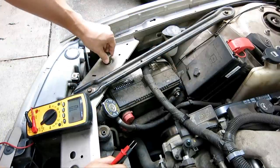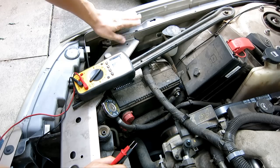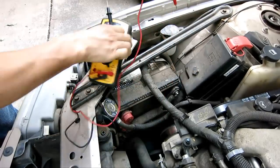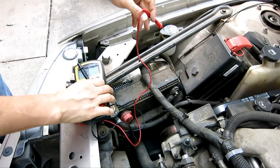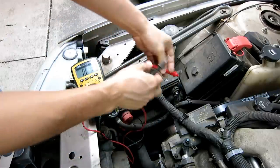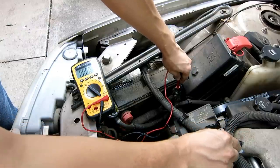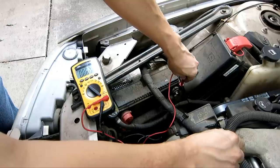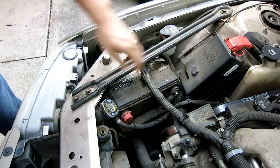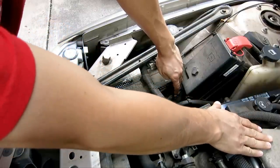One of the reasons for that procedure is that the chassis or frame of your car is connected to the negative terminal. If you look at my digital multimeter here, I have it on ohms, and if I measure the negative terminal to the frame of the car you can see it's zero ohms. So what that means is that if I'm touching the negative terminal right now and I'm touching the car, it's the same spot.